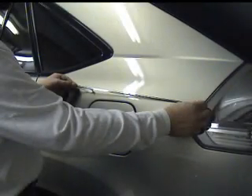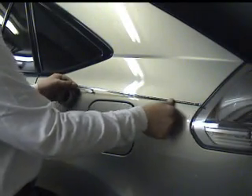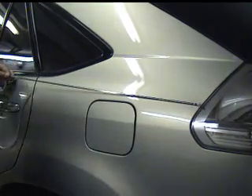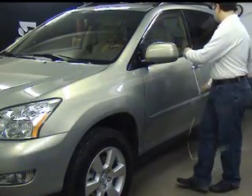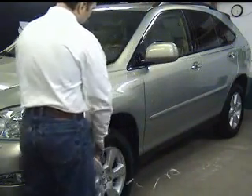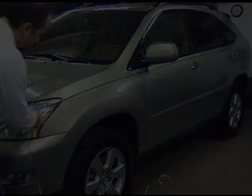Now, with the white part of the stripe down, go ahead and temporarily place the stripe tape on the vehicle, with about 12 inches more than you need extended past where you plan to trim. This will allow you to handle the stripe without getting finger oils on the part of the product that's actually set on the vehicle. I pulled the stripe all the way to the front — this allows the stripe to flow continuous. It's very difficult to place pinstripe on each body panel, for example fenders or doors, without the appearance of kinks in each segment.